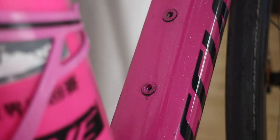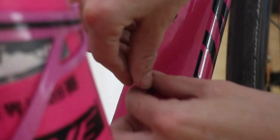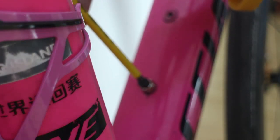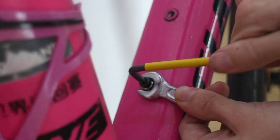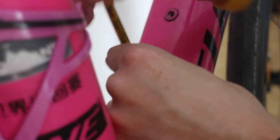Since we're here and we've already got the cage off, we may as well do the other bolt as well. For me it was just this one that had worked its way loose - obviously as you put the bottle in and out, this one gets a lot more abuse. But as we're here, let's give this one a bit of a tighten too. Prevention is a lot better than cure on this job. Get it finger tight, grab your 10mm spanner to stop it from spinning, and just give it a bit of tightening. That one was loose by about a third of a turn.